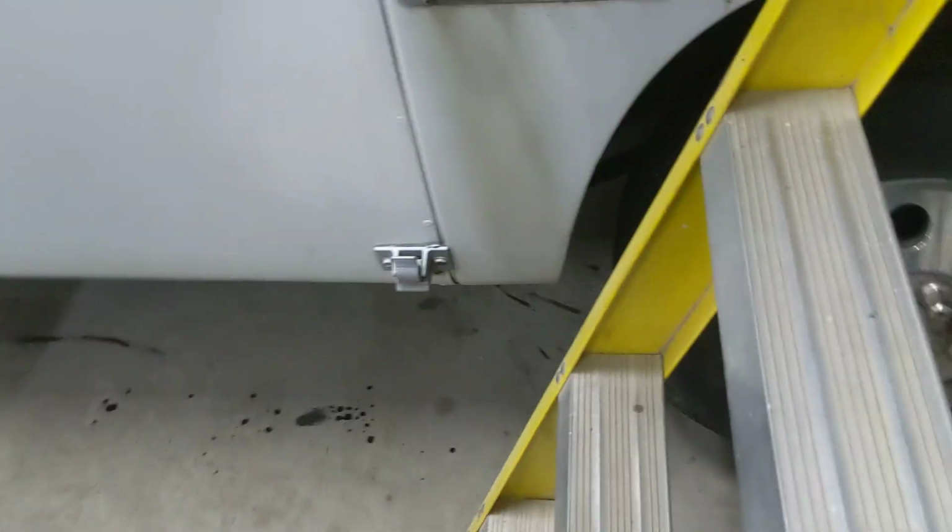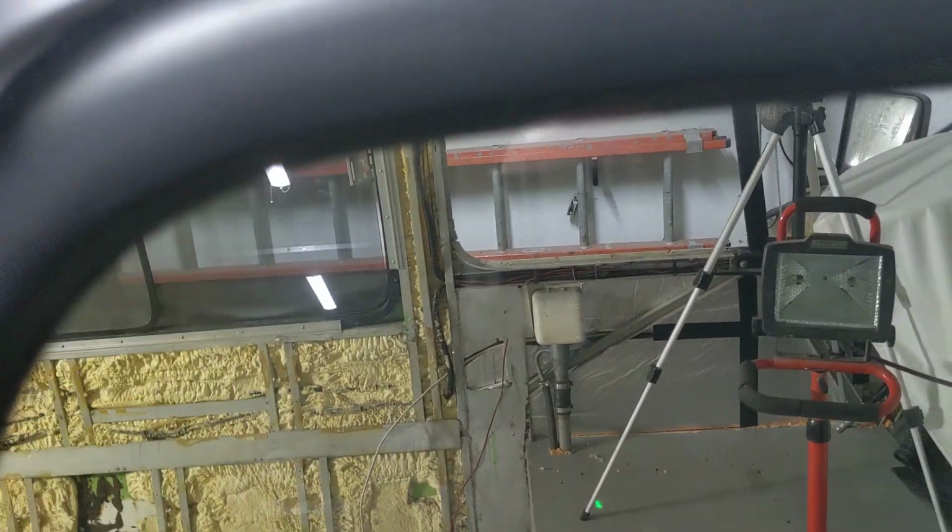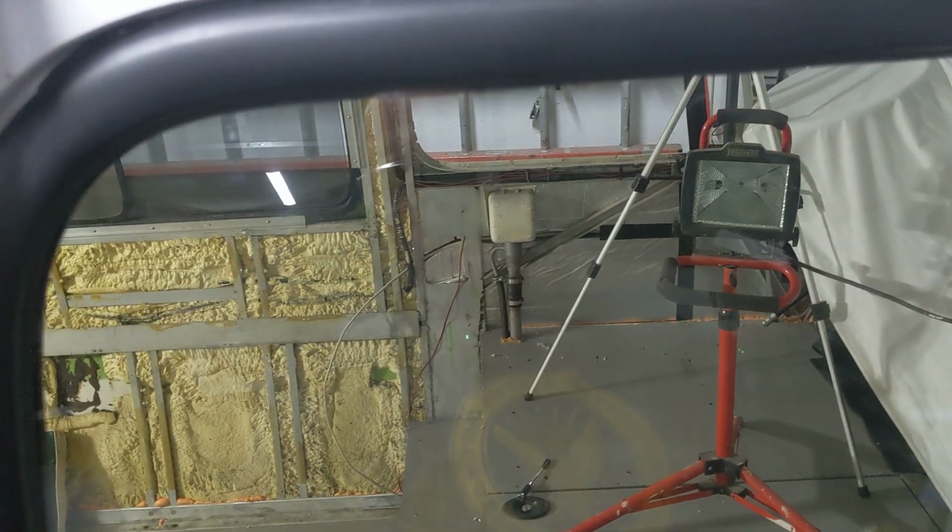All right, so as I told you, come out here and take a look. You can see we squeezed out pretty good. I've got kind of a gaposis right there, so I'm going to have to look into that, make sure that there's enough sealer there. Obviously here you can't really see. It's kind of dark in there. Then up here at the top, I'm seeing quite a bit of squeeze out almost all the way along. So I think I'll get a little tool and tool that joint and kind of clean it up a little, and we'll call it a day.